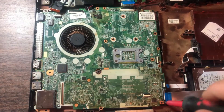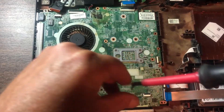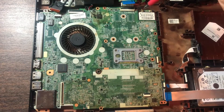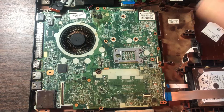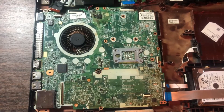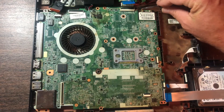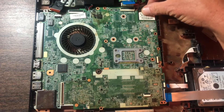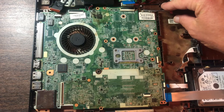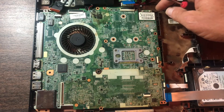And that's the only ones I see. Let's take that one out right there. One more thing I forgot — right here is your WiFi antenna. In case your wireless ever goes out on the laptop, you can replace these. You can see it's got a little connector piece right here that just pops right on that receptacle. Definitely want to remember which side it was on — it's on the left side in this case.